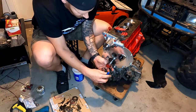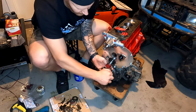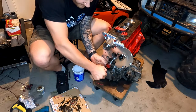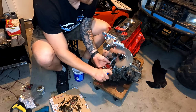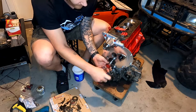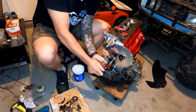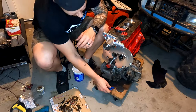You're probably wondering about this quad bike behind me — I've started quoting the job. We're going to be replacing the top end on the engine, doing a piston, set of rings, head gasket and probably a set of valve stem seals, because it is burning so much oil it is out of control.